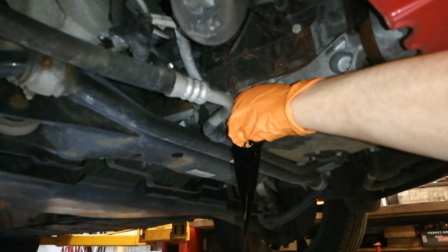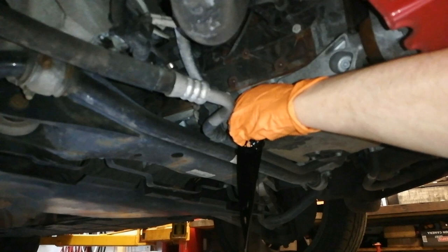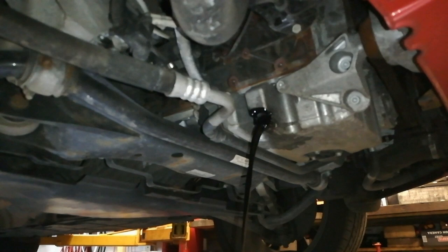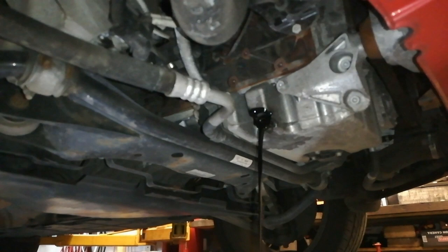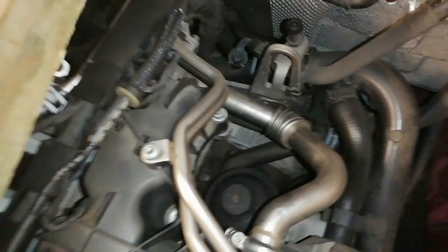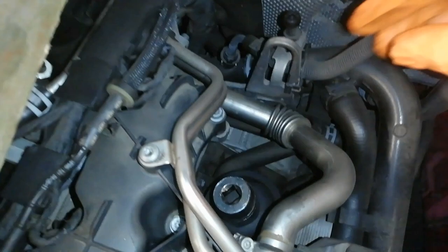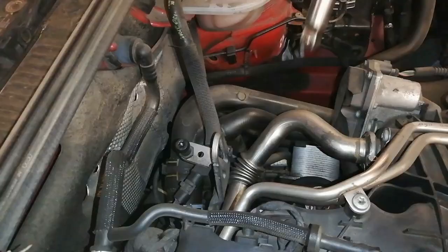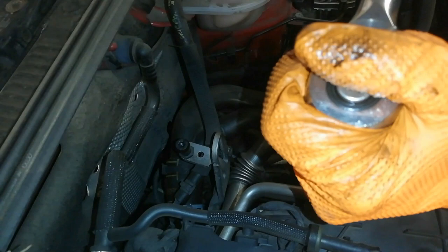Cars with a lot of oil in them — that'll just fly out if you release the plug. I've moved the bucket back down under the car. The oil filter cap is a 32mm socket. Sometimes these take a wee bit of effort to get off.